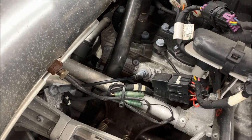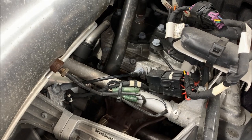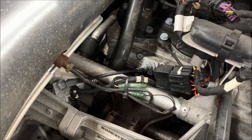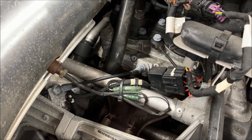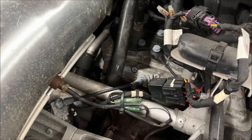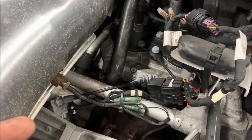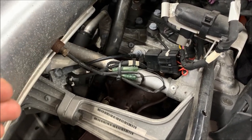If all we're going to do is clean these, you don't want to touch the cable at all. With the servo and the actuator there is a position where it needs to know where it needs to be, and if you change that it changes the position of the valving. There's nothing you can do to remedy it at home — you'd have to bring it to a Polaris dealer to get it relearned. For the sake of cleaning them, we're going to leave the cable intact, remove the hardware, pull the valves out, lay it down on the bulkhead, and do all the cleaning inside the sled.